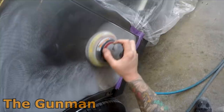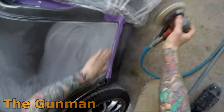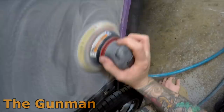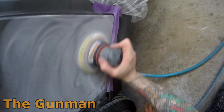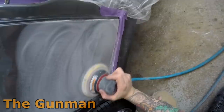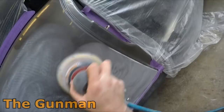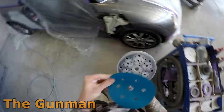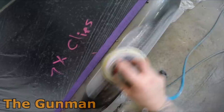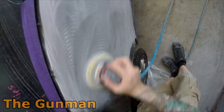Something I've been doing lately is leaving the car covered while I do my prep work. It only takes an extra minute because the plastic's already over the car. I'll just reuse that plastic tape around the panel I need to prep. It keeps the car cleaner and if I have to leave mid-job, it saves Alan from having to throw plastic over the car again. I'm always trying new ideas and little tweaks to make myself a better all-round painter.